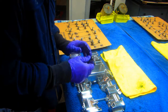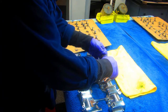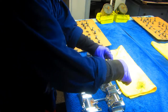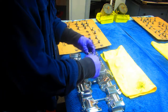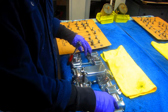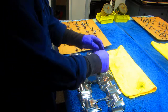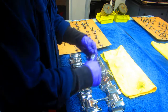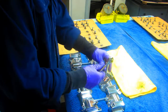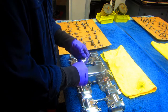And I want these, again, whoops, these are the typical screws that if you over tighten them, they strip very easily. So the blue Loctite, and I'm doing them in a cross pattern. And actually the factory manual suggests that when you tighten the screws, tighten from the inside out. Well, I guess we're going to go by the factory manual, since they know a little bit more than I do. But then everybody does. Okay, so these are snugging up real nice. And the trick with all of this stuff is not to tighten one screw and then do the other ones.